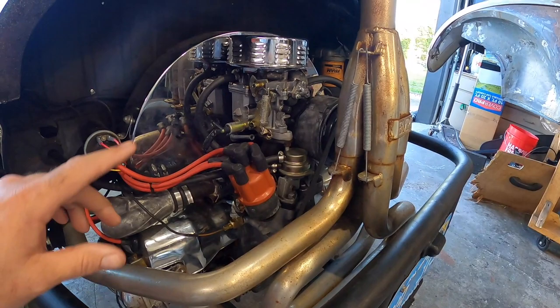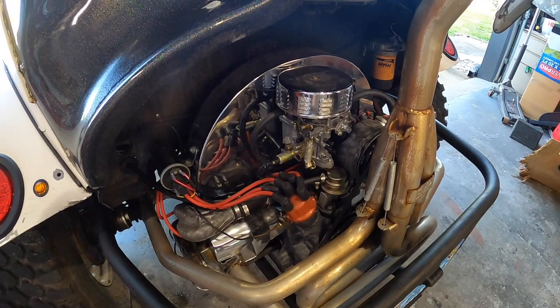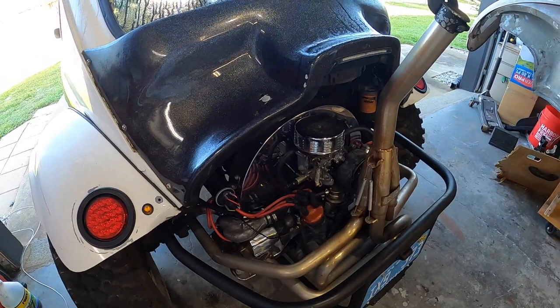But you need to pull your carburetor, fan shroud, intake manifolds. Of course, with the fan shroud, your alternator or generator is going to come off with that. The reason you need to do that is you need to be able to get your head tins off, because you got 4 bolts on the top side. So once we get the top end kind of stripped down, we'll bring you back, and we will show you from there what's next.